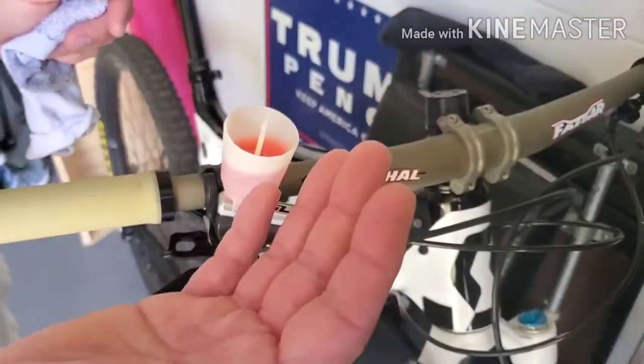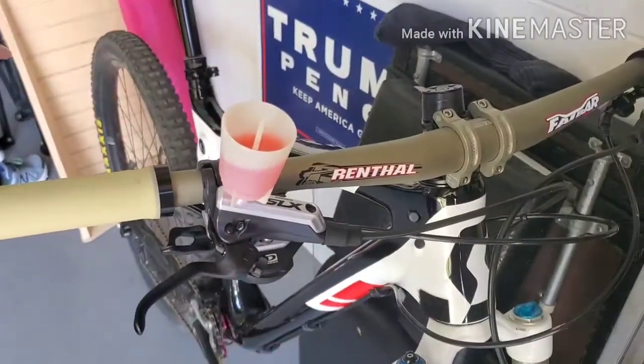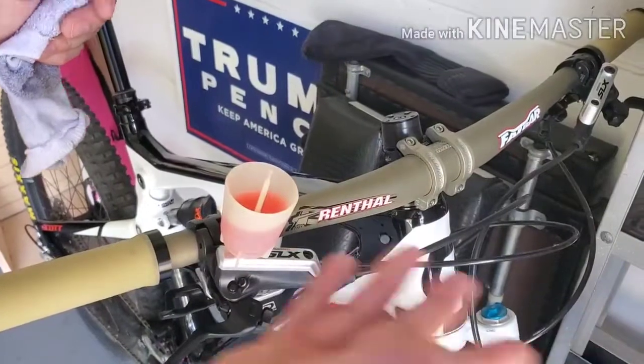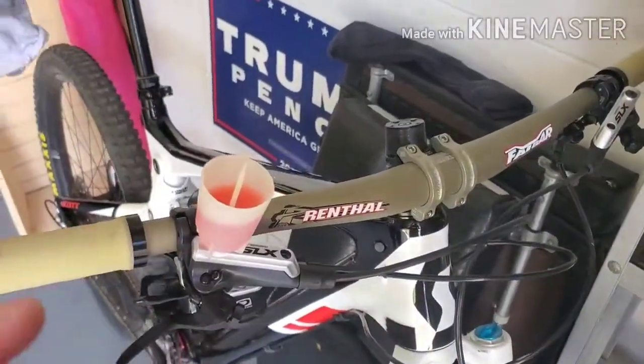What's helpful is to just do this every once in a while. I did a full bleed, rode it for a couple weeks, and now I'm going to burp the system. What I'll do is in a few weeks from now, I'll probably do it again. And each time I do it, it should get better and better and a little bit tighter.